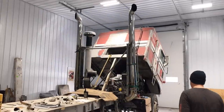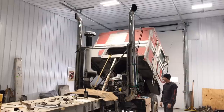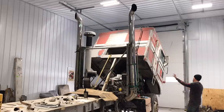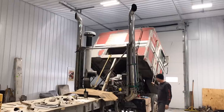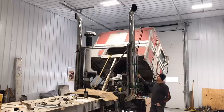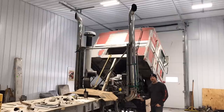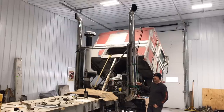So this is going to be the Iron Duke. This isn't going to be necessarily an exact movie replica from the Highball movie — it's just going to be more of a tribute truck in the spirit of the Iron Duke. I am going to paint it up the same way; it's the same size cab and we'll go with the same paint scheme and put Iron Duke on the front. After that, I'm going to put my own spin on it. I was going to put eight-inch pipes on here with flat tops and flappers, but I actually purchased some different pipes — seven-inch with elbows, picked up used off Kijiji for a couple hundred bucks each. They were too good of a deal to pass up. They're a little rough, but they'll work until I can save up to buy the eight-inch Lincolns I want. I'll raise them up, get some new brackets, and get some flex pipe into a Y-pipe off the turbo so we can at least use them to drive the truck around.